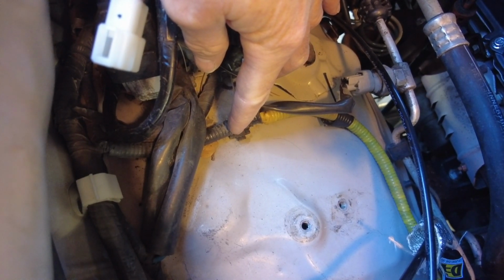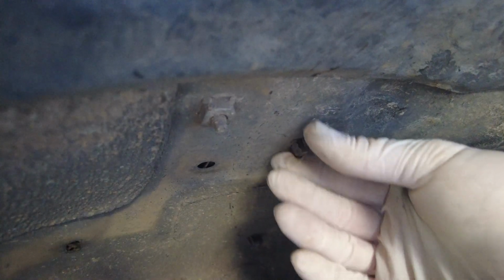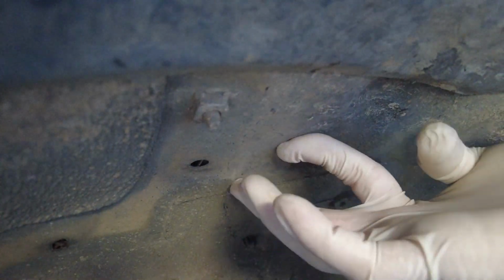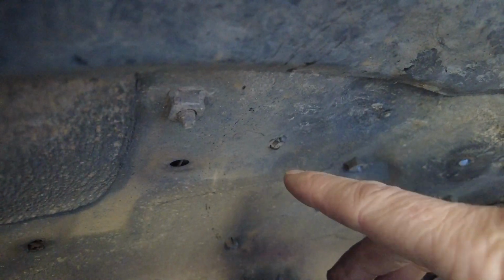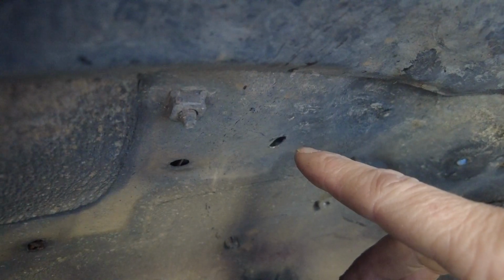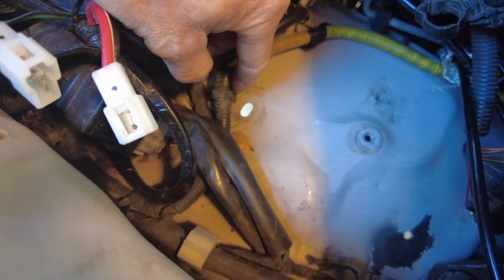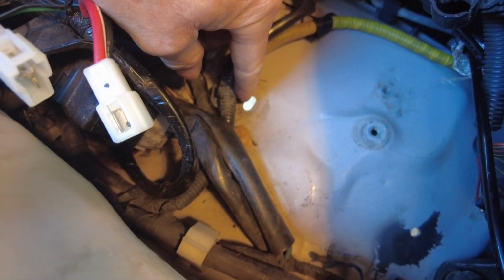And that's what we're going to do right now. It's this clip right here, right above your shock tower and upper control arm. He did it with his fingers. If you find the clip is a little tight, you can do it with some bent nose needle nose pliers or straight nose needle nose pliers or any type of pliers, and push it through. Now you can see that this clip is free of the body.